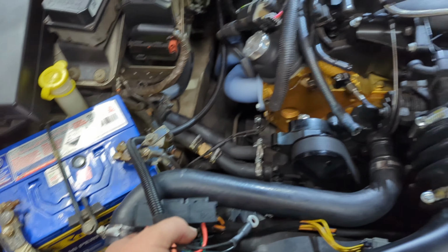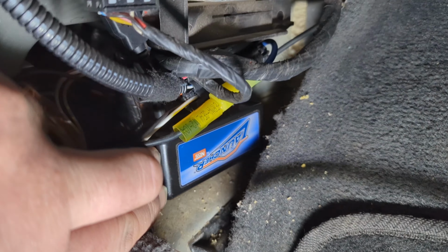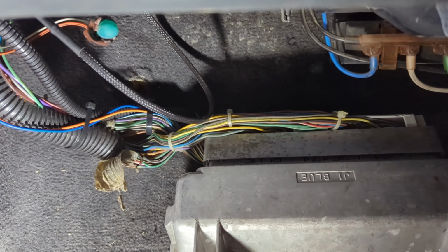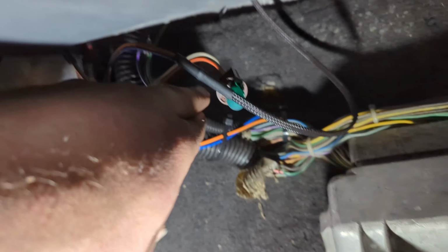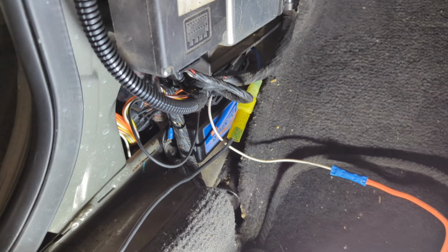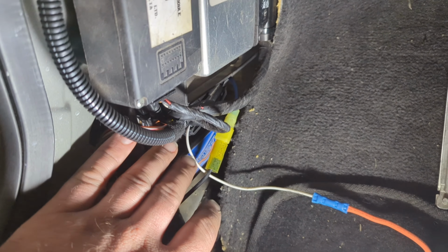Go inside the car. So this is a nice launcher system, a little computer system that controls the nitrous. That is piggybacked into the ECU here, through these wires which go in and read the TPS and read the engine RPM. So we set a TPS point we want and an RPM trigger point, and the nitrous won't engage until those are met,